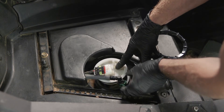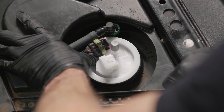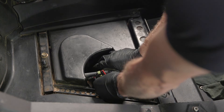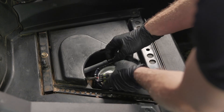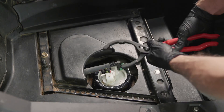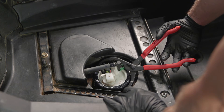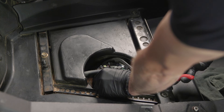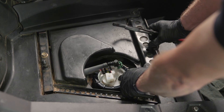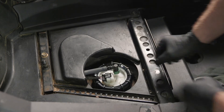This thing is spring loaded, so when you put it in, line this arrow here with the two marks down on the tank — put it right in between — then press it down into place so we can get the plastic nut screwed on. I've got the nut as tight as I can by hand, then I'll use the oil filter pliers to tighten it down the rest of the way. If you use the special tool, Polaris wants you to torque this down to 70 foot-pounds. Before and after final torquing, make sure you're still aligned with the marks on the gas tank. Now we can reinstall the fuel line, electrical connector, and reinstall the passenger seat.